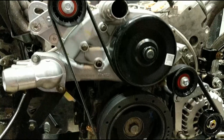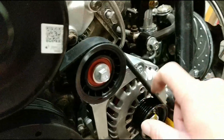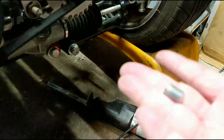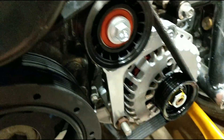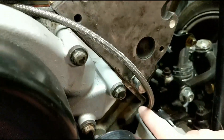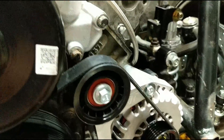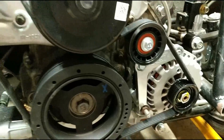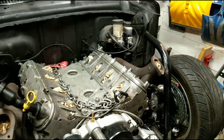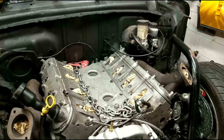Got the belt stuff finalized. I cut this off a little, still left a little bit out in case I need to do anything there. I never could get the bolt to go in proper, so I just cut about that much off of it and bolted it in, so hopefully it'll be alright. This hole in my block has definitely got something going on, so next time I have this all apart I'll probably tap that hole and replace that bolt if there's an issue. Let's go grab the hot side and get it put on, and I'll probably go ahead and put the intake on too — get that cleaned up a little bit just so we'll be ready for all the other stuff that needs to go there.